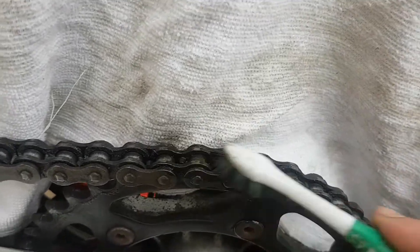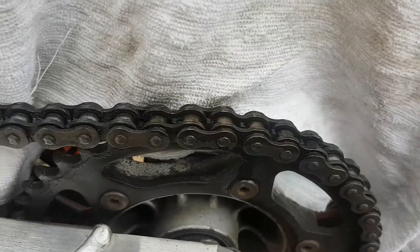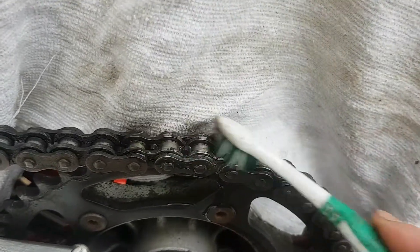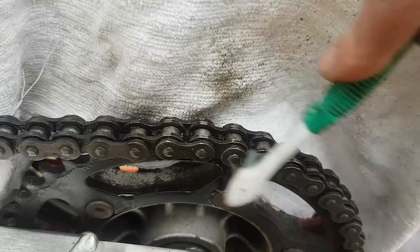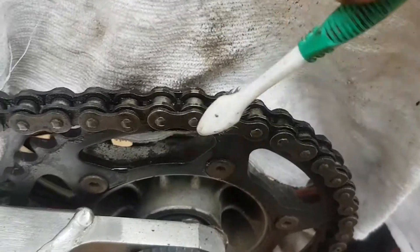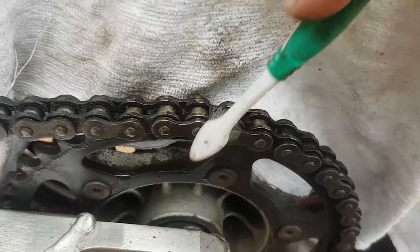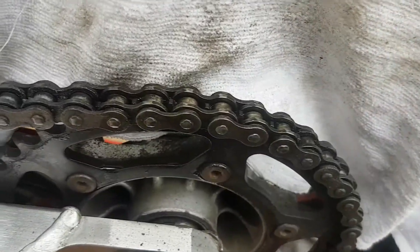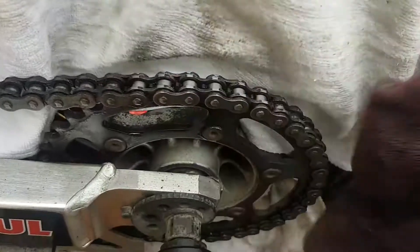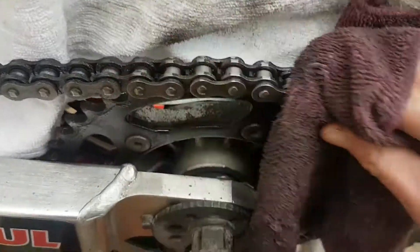Grime, road shit — put some of it on the toothbrush, give it a little scrub. You don't even have to scrub that hard really. You can already see it working. The paraffin doesn't affect your o-rings, which is good. Just do a little bit to show you — get right in there — and after this when you wipe it all off, just use another rag. Look at that, what a beaut.